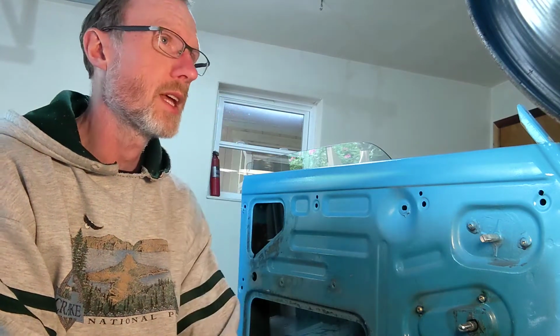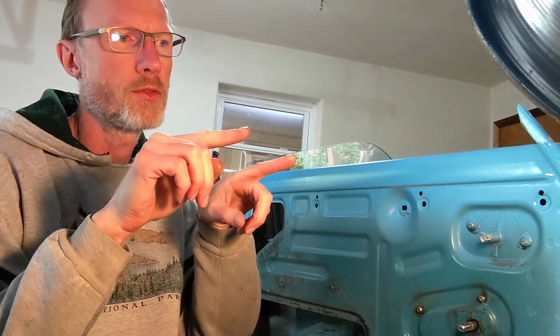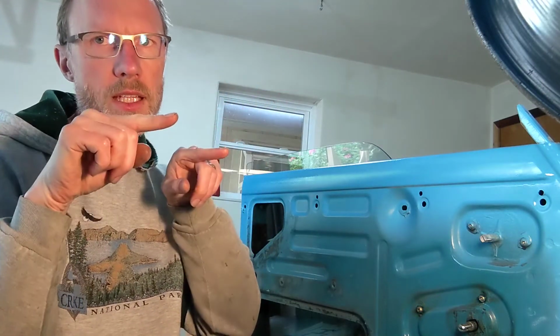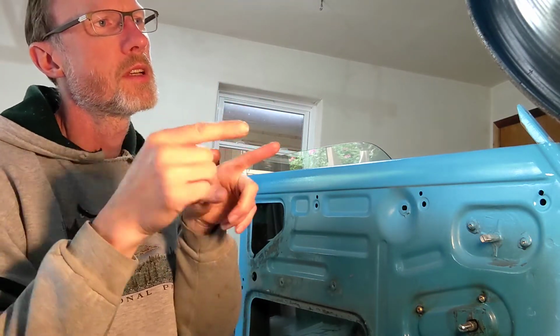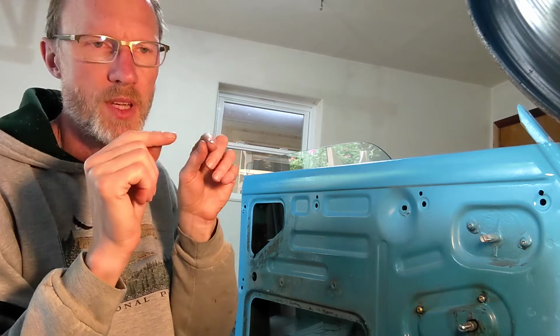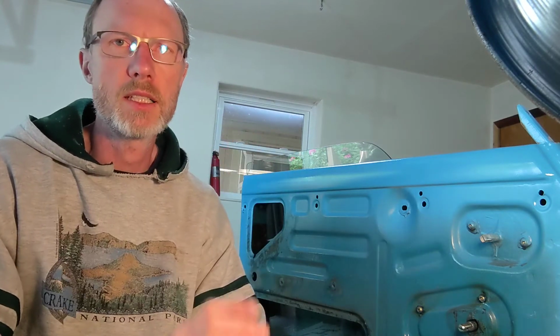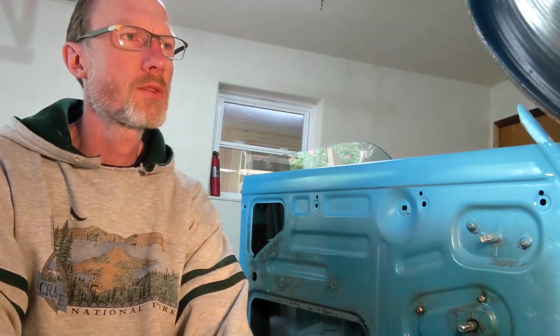That was a 2-day project that I thought was just going to be an install, where the windshield wipers come out. It has these swing bars underneath that move what moves the windshield wipers, right? And they stick through these metal shafts. They call them pivot shafts. And they were rusted inside of there, solid, so that they wouldn't move. And I had to get those sleeves off somehow without destroying the threads. It was a whole ordeal. It was crazy. I ended up, like, at the end of the day, taking the thing completely apart, welding the stud back on to the little pivot point and the whole thing. It was quite remarkable. But now it's perfect.